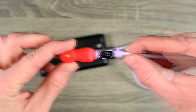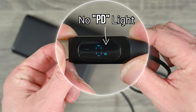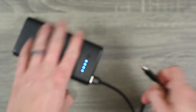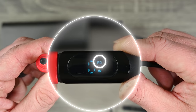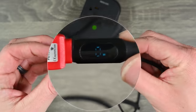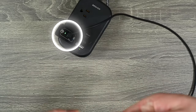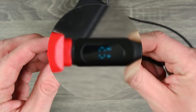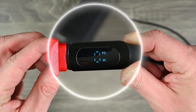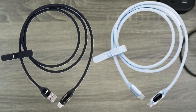You can see this device is powering it. When I plug into this little portable power bank I've used forever, you can see that the PD symbol does not show up — so this power bank does not provide quick charge, and therefore it will not work. I'm going to plug into this extension cord that has some USB-C and USB-A slots on it. You can see that one is not working either. But when I plug into this power adapter, the PD symbol does show up. Basically, if you see PD, it will work. If you don't see it, it's not going to work.